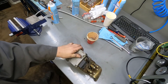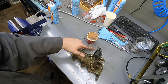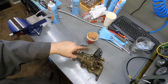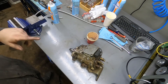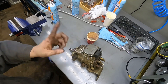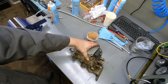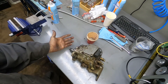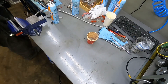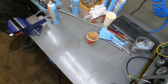This is the brain for the injection pump, and a lot of times what happens is these overheat. When you have an overheat issue the pump is basically junk. There are some videos out there of guys going in and re-soldering broken or bad connections. This is a pump that's bad — maybe one day we'll tear one apart since I have about a half dozen of them.